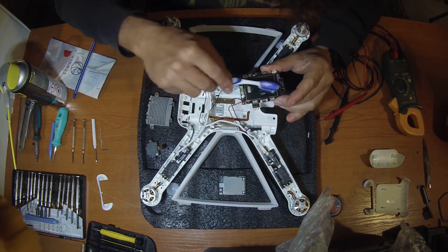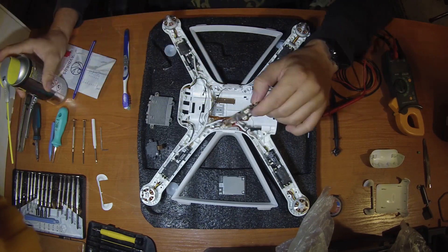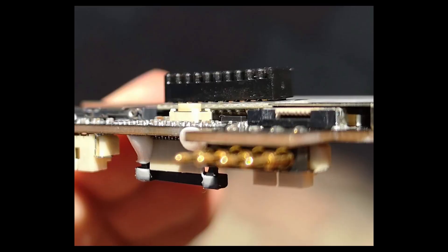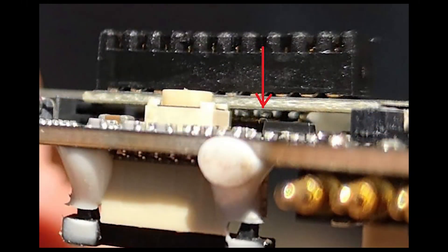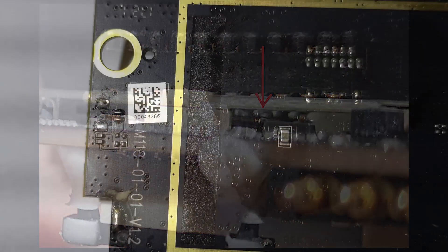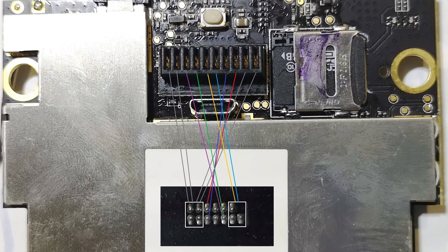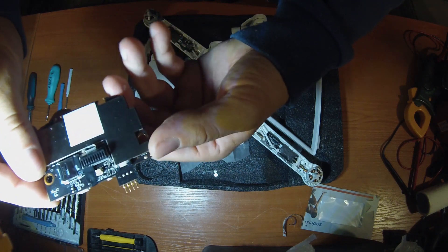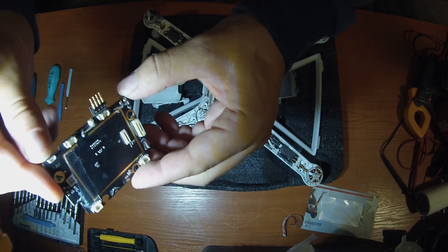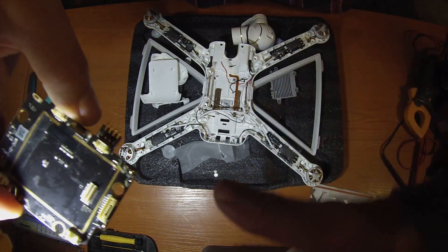Then I tried to clean it, however this was unnecessary because the issue was in the socket here. This is the third pin. So I made a shim from the back of the board to the front — this is the shim. The red pin was the issue here. So this is how I repaired it: just make a connection between the back and front of this pin, and the issue was fixed. Thanks for watching, see you next time.